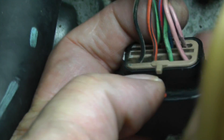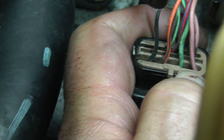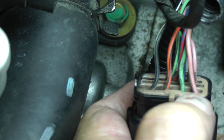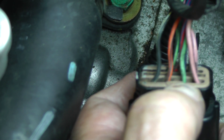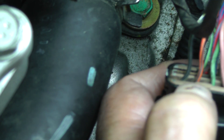Moving to the bottom row — remember I flipped it over. This is all for reference, not for TCM measurements. I mentioned there were two other switches in here. Pin 7 is a pink wire, and pin 8 right next to it is a light green wire. Those two wires are for your backup lights.